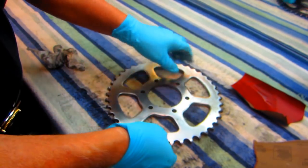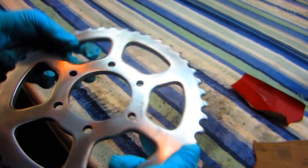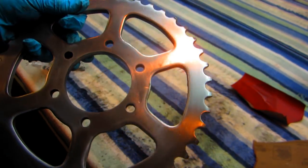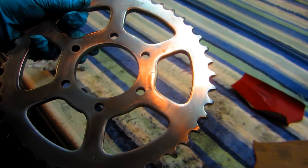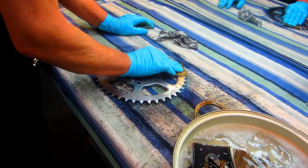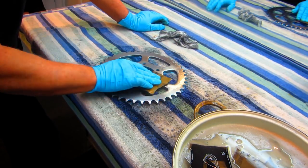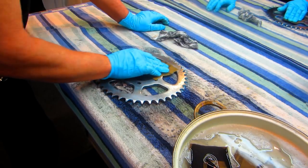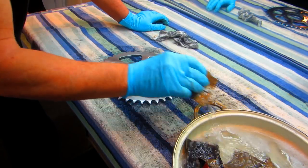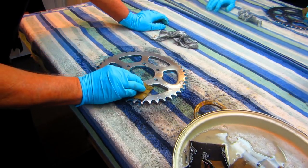And anyway, the 400 does take the scratches out a little quicker, but basically all the scratches have to come out before we go to the next step. Now, worth mentioning, this is the way this totally played out. I did the whole part with 400, then the whole part with 600, and back to 1000, and I think I've got most of it ready for, this is the part that takes time, by the way.